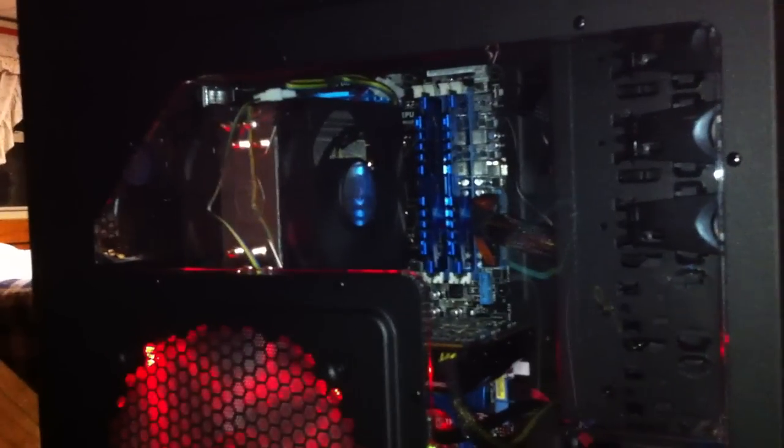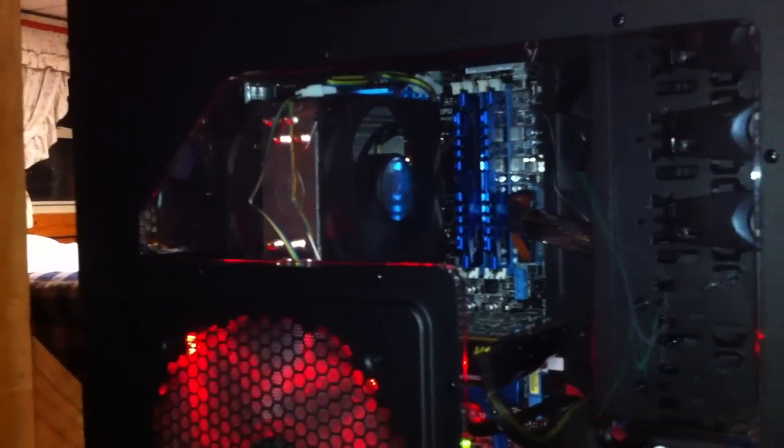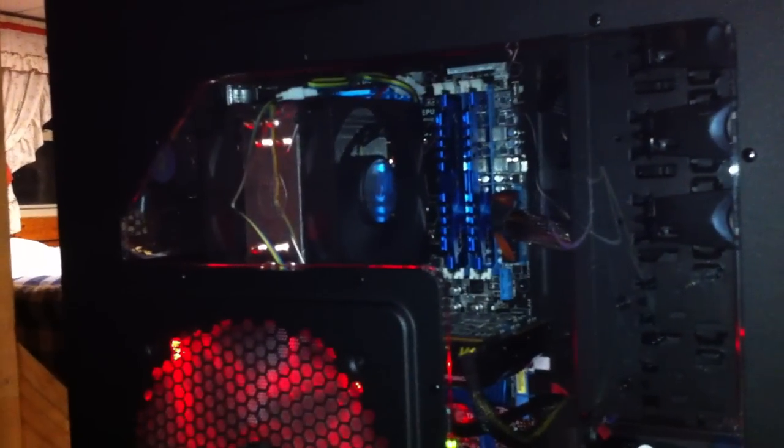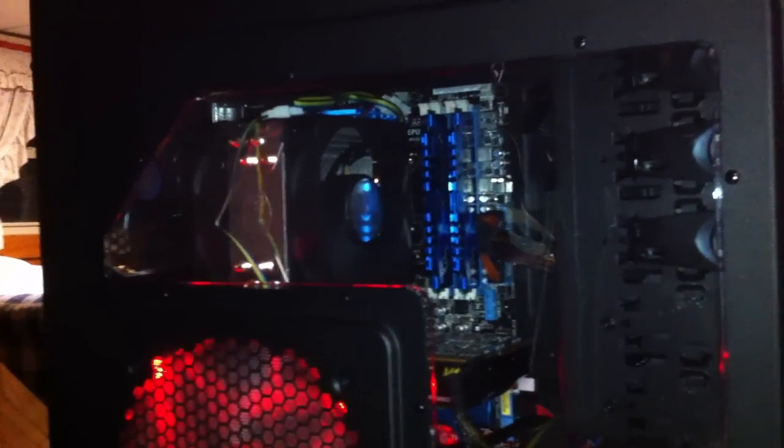It's like if you were having to go manually into the BIOS and change all these different settings to overclock your CPU, it does all that for you, and runs stress tests and whatnot to overclock your CPU within set safe parameters. Once it reaches its max limit of what it thinks the CPU can handle, it'll stop. But basically, it's a program to give you a maximum overclock out of your CPU without you having to do it. So a really cool feature there.